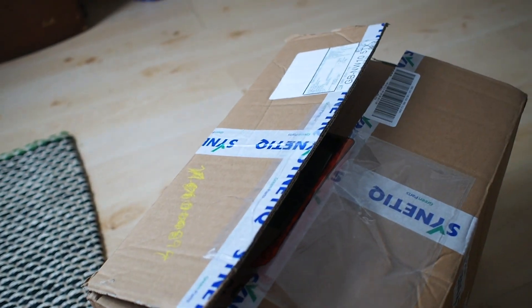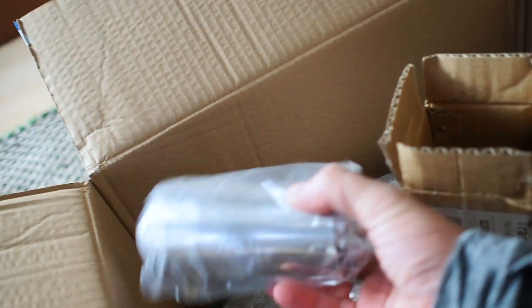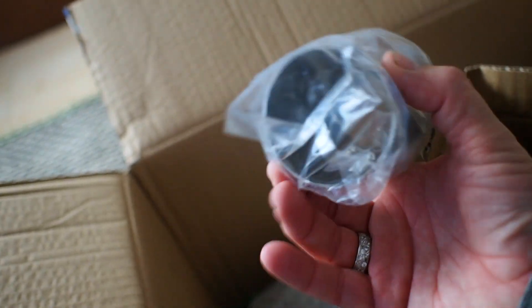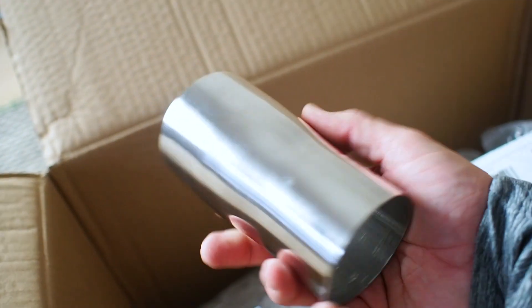So I've mounted up the radiator for the charge cooler. Here's another box that arrived with a few bits I needed - the actual charge cooler itself and some connectors. The first item is the intake pipe I needed to finish the intake, so the turbo is almost done apart from the downpipe. It's 63mm at one end and goes up to 70mm, which matches the standard VW intake pipe. I'll also put a pipe coming off here so the breather can return to the inlet and it looks OEM - I'll paint it all black.